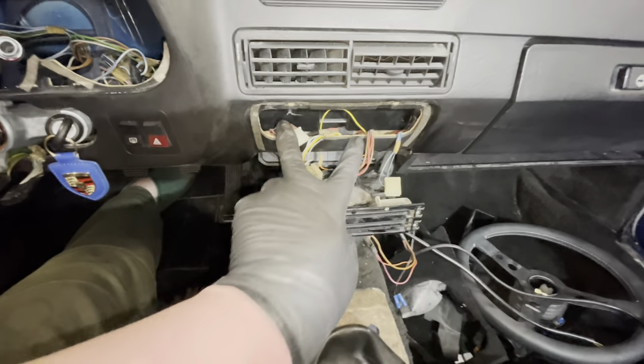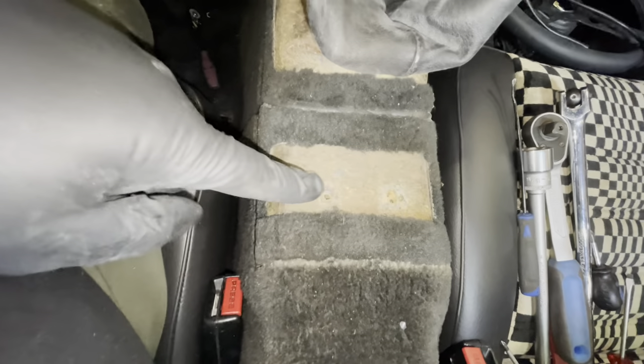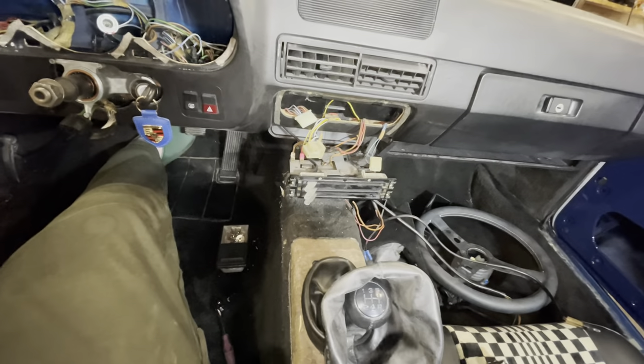Whereas on this early type dash you literally just have the two screws and the rest is a press fit. Be sure you do this correctly, otherwise you will break it — and these things are no longer available and very tough to find in good condition. Once you've done that, it's a matter of removing those two screws here, those two screws there, and then the screws on the sides. Both sides have a screw and then you can pull the whole center console back.